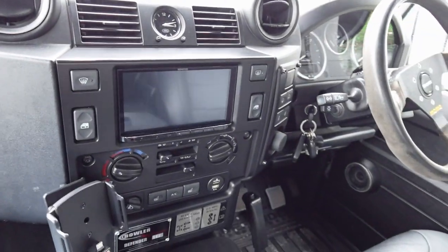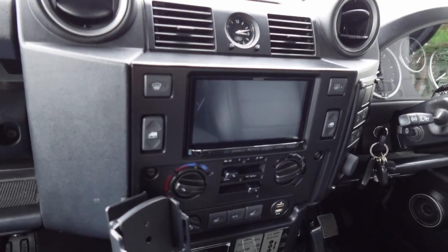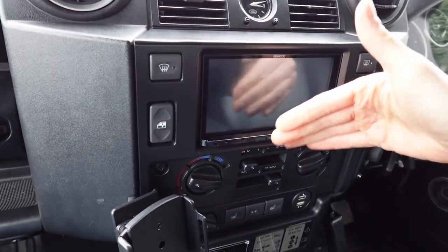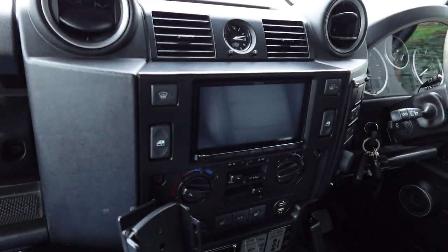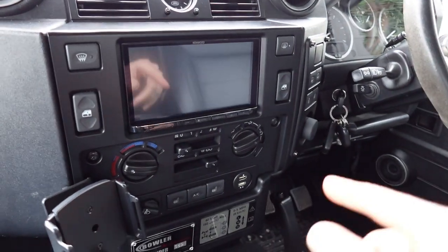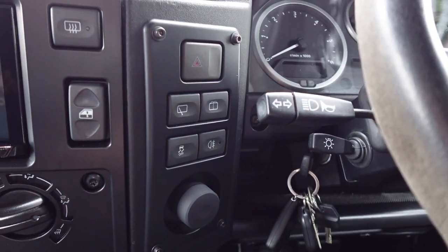This video is a short video to show you the Kenwood system, and I'll give you a quick run through what we've also done. We'll start at the front. This customer came into us with a Kenwood — sorry, Pioneer — flip-up screen, and wasn't happy because when the screen was in the up position it obscured the hazard switches. So what we've done is converted this dashboard to a double DIN to allow the Kenwood to fit, and the buttons get relocated to the right.